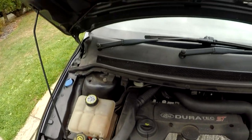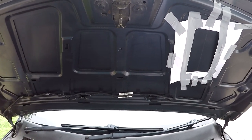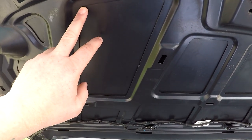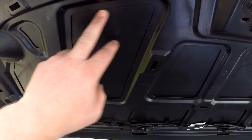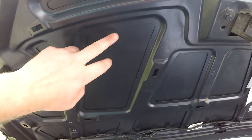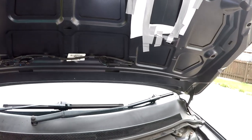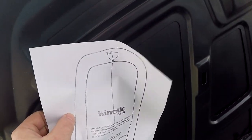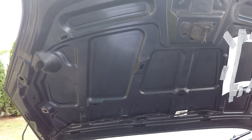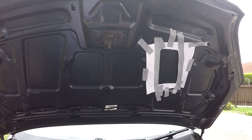Repeat the process on the bonnet. As you can see, the panels already have the angle and shape in place where you want to stick the air vents. Mark across, measure across, mark the center piece, mark across again, mark center piece, and draw a straight line. Then from top and bottom, mark up and down three centimeters. On your template, marry it up on the bonnet — that should leave you with a symmetrical square template cut out on both sides.